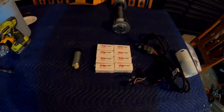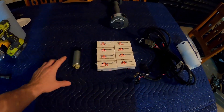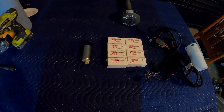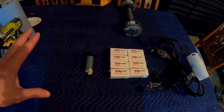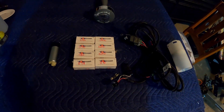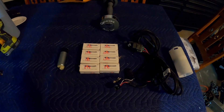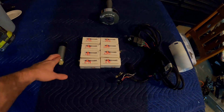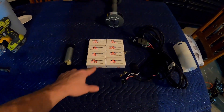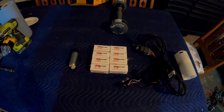I'm just going to go over some of the parts you guys are going to need for this build. Here I have a 340 fuel pump — this one I got from TRE Performance. I'm sure you can find them everywhere else. Feel free to explore and post comments if you have a more budget-friendly alternative. The TRE Performance fuel pump was about $100. I went with TRE Performance 120-pound injectors; I believe the entire set cost somewhere around $200 to $220.